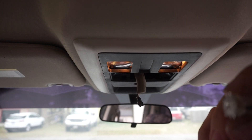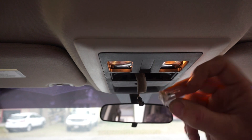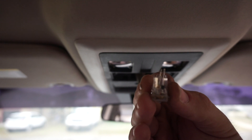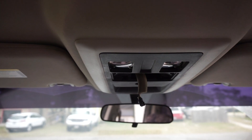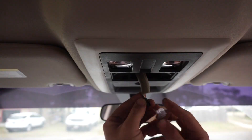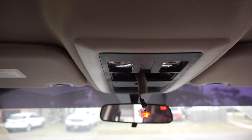Keep in mind if you use super glue, you need to use a super glue that does not haze. You need to actually test your super glue out - make sure it dries clear just like this stuff right here. That way you don't get that white haze in your lens. I've already prepped this one - you can tell I've bent the ends over on those two wires coming out of that LED. This is the finished product - you're just going to have them both sticking up. Next, make sure your interior lights are on, your driving lights and everything around you. You want to stick this guy into the plug and make sure it lights up. It's only going to light up one way - so it looks like we hit it first try. If you flip it over it doesn't work. If it doesn't work then you've got it backwards, so bend those ends, flip it, make it fit, and shove her in there. Now she's nice and solid and not just going to fall out.